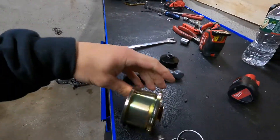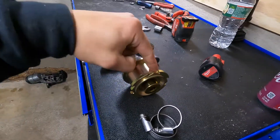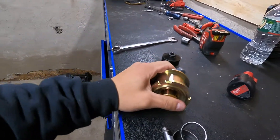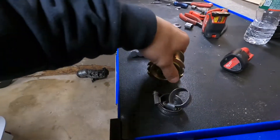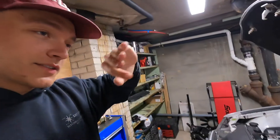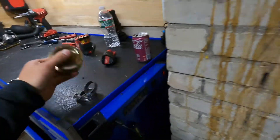I got these PBM spherical trailing arm bushings because the solid ones are trash. Any solid bushing is trash because you need the trailing arm to flex so you have movement in the suspension — it can go like that. That way you have more grip. With a solid bushing, it ain't moving, that's it. You need that movement — I've come to find out.